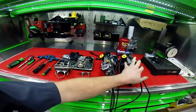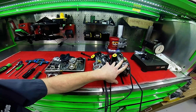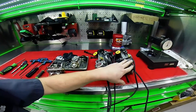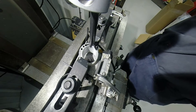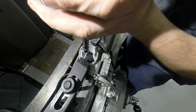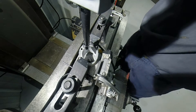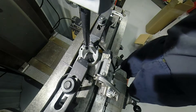Here are a couple more — we've got ones that are both bored out already, ready to go back out. Now I'm going to take you over to the milling machine and show you the last operation we've got left to do on it. We're going to run it in low gear — we get a better finish that way. We're going to move it until we get it locked in low gear, right there, then spray it with some WD-40 to get a little better finish. And here we go.